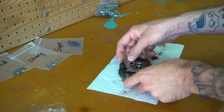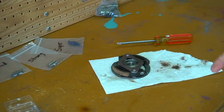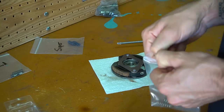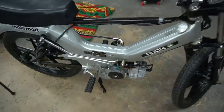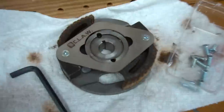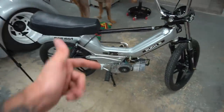The plate's all the way down and we're not rubbing on the pads, so we can throw everything in — springs and loctite that plate down. We're going to go with the strong springs — I have standard, strong, and super, and we're starting with strong. Time to throw the new clutch in: pull the old one out, put the piston stop in, crack this bad boy out, and put the new one in. Hopefully this will be the first time we really get to try the Pook.